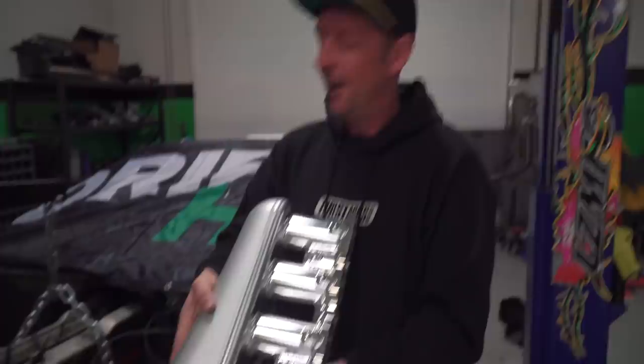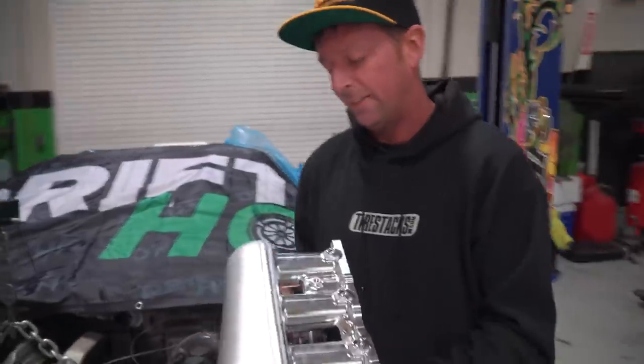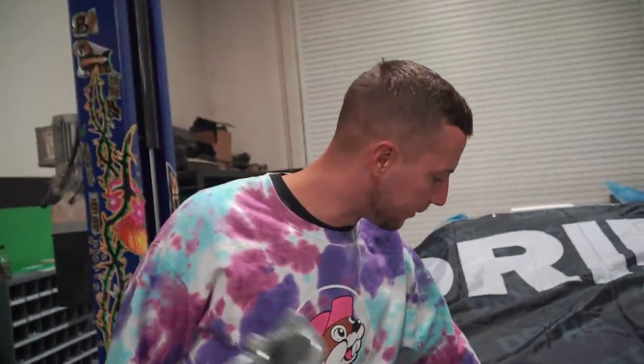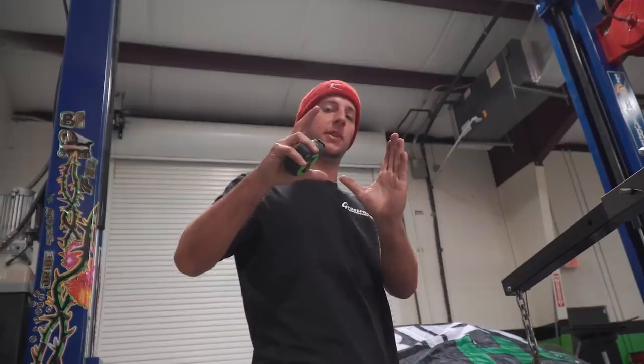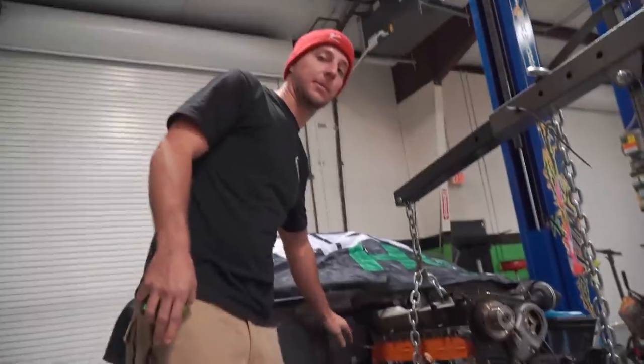We have a Plasma Man intake manifold. Unfortunately, with the RB, we have to put it farther back into the firewall to clear the pulley — it's about where our notch on the firewall is, and we have to go all the way back. So that piece he just made for the firewall, now that we have our Plasma Man — which would have been nice if it was like two inches shorter, we want the plasma boy, the little guy — unfortunately we're gonna have to take this and cut a little bit more of the firewall out on this corner just to make some more clearance for our intake manifold. So we went over to the R32 that's over there and measured the pitch on the motor. These motors actually sit about nine degrees towards the exhaust side. So now we adjust our pitch so that matches that, because the oil pan actually has a kind of a pitch to the base of it too. Now our oil pan sits almost level. That tilt actually might have got us all the clearance we needed for the intake manifold — so we might not have to chop that up after all. Hopeful.